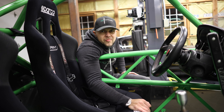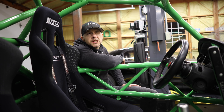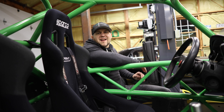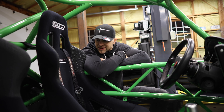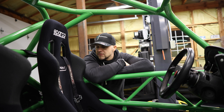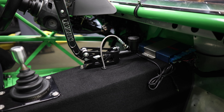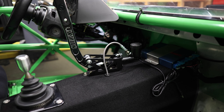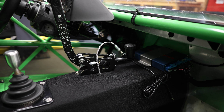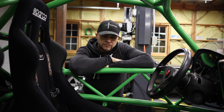Sign us up for Formula Drift — Formula D US. Are we going to drift this thing? Not seriously — we just want to have fun. Let's call them power slides. The hydro e-brake is all mounted. Quinn found a grommet — an S2000 valve cover grommet — and it's tight on the line so it doesn't rub against the aluminum tunnel. Next we're going to install the second set of rear calipers, finish running the lines, and get this thing bled.